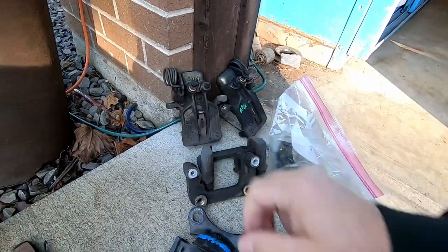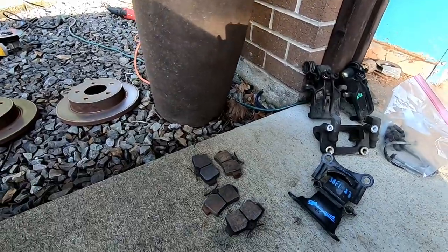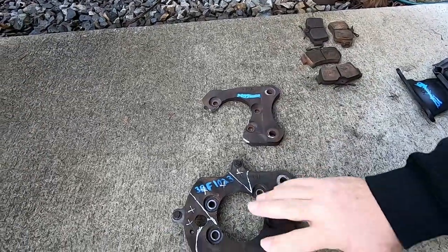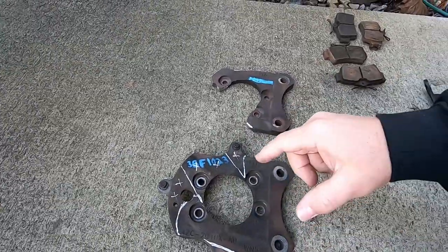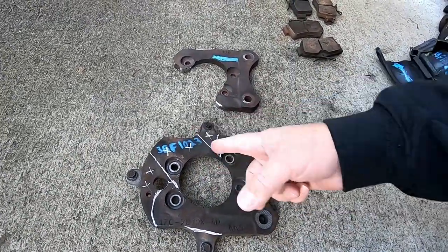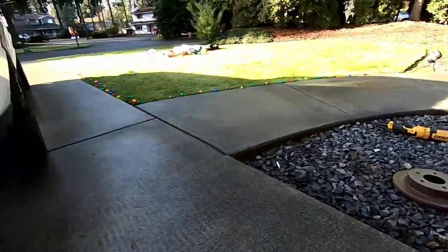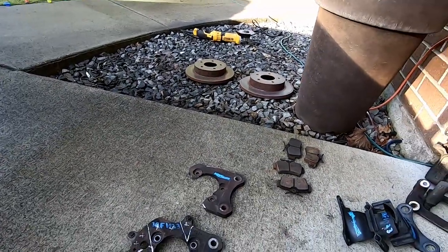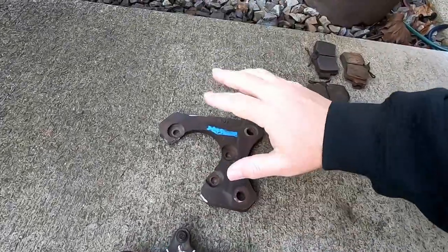Caliper brackets, calipers — these have the built-in parking brake, which can be adapted easily to the Ranger. These are the brackets off of the Mustang rear axle. They get switched from left to right, so what was left on the Mustang axle is going to go on the right on the Ranger axle. It goes on the opposite side of the flange. To slip it over the axle tube, you have to cut a section out. There are several videos on doing this swap onto a Ranger, but they're a bit short and don't show a lot of the technical aspects.